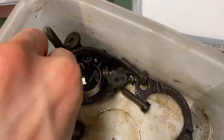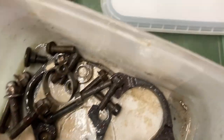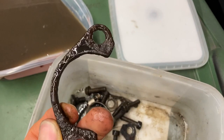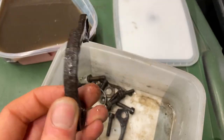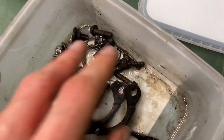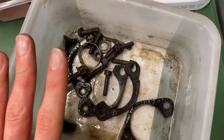Wow! That's actually — wow! You can probably tell there, and they're still not immaculate, let's be clear, but so much of the rust has gone, and most of the brown has gone from there. That's like actually grey. It doesn't look brand new, but compare right now — flashback to what these did look like — and look at what they look like now. That's amazing! All that kind of scunge sitting in the bottom there is still contaminant — there's still bits of dirt and undoubtedly rust that's been lifted off the surface. So I'm going to fill these with water, wash them off so they don't go all sticky, and then we can get a look at the final results.